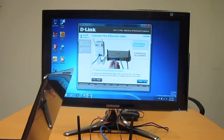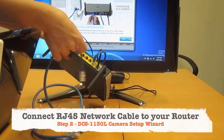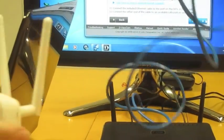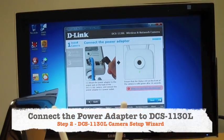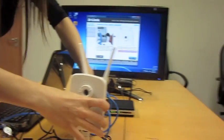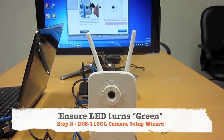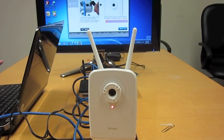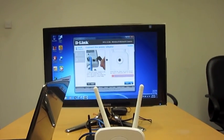Click next, and the instructions say to connect the RJ45 cable. I'm first going to connect it to the router — this router has four ports, so I'll just use any one of them — and then connect it to the ethernet port on the camera. Next, I'm going to connect the power cable. It says I have to ensure that the LED status is solid green after 30 seconds. It's still red... and now it's solid green, so I'm going to click next.